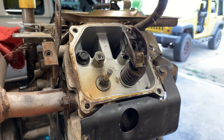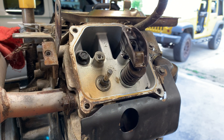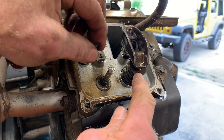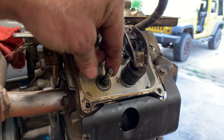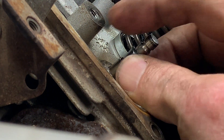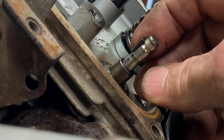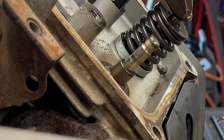It wasn't able to release the exhaust pressure, so it was working against the other cylinder, making it a real rough-running engine. I found that one of the keepers — one of these guys right here — had come off and was just floating around down here. The keeper is responsible for holding the spring in a compressed state about the shaft. There's a little groove right in here that the keeper rides in, and there are two halves of this keeper — one half had come off.